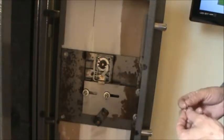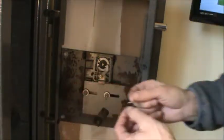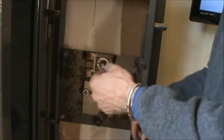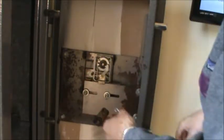I've taken this piece off and removed the tiny little spring. What I'm going to do is try to replace it. I went to Lowe's and got this spring here. I'm going to drill a couple of holes — catch that screw and drill down there — and see if I can get a different spring to pull. I've got some screws from the door, so the plan is: put a screw here, hook the spring, drill a hole, put a screw over here.